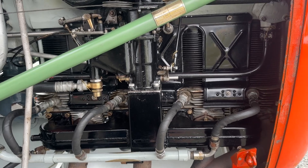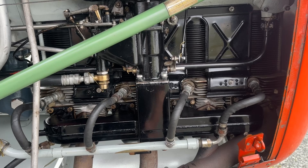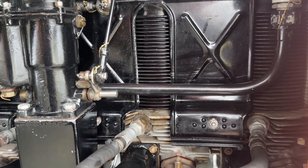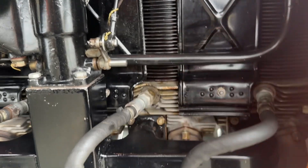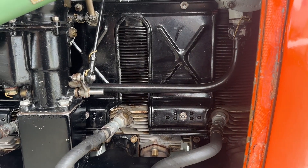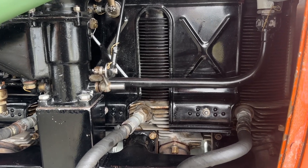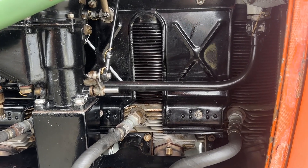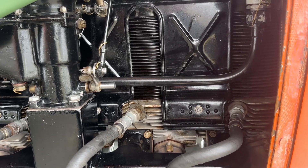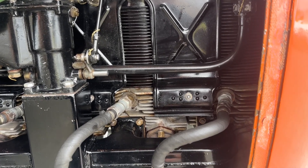Let's look at the cylinders in a little more detail. Looking at number two here, it's got fins on it — both on the cylinder and on the head — these horizontal fins, and the idea of those is to remove heat from the engine. It's an air-cooled engine, with a little bit of help from the oil and fuel. Air comes in the front, it's directed through baffles, and out the other end, taking away a lot of the heat energy.